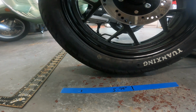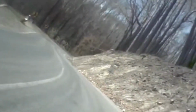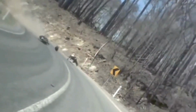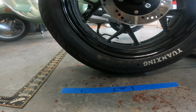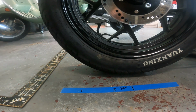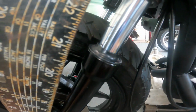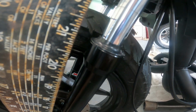So when you add throttle, it raises the front of the bike. It actually increases trail, and it makes the bike even more stable. So you swing wide and you go off into the ditch, or you go into the oncoming lane and hit a car. That's why they limit the maximum trail. Too much stability can be bad in the corner. It can be dangerous. Oh, and I'm measuring trail at a race sag with you sitting on the bike where it compresses to.